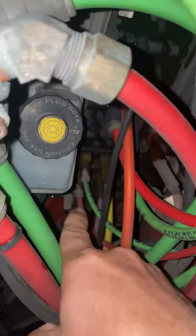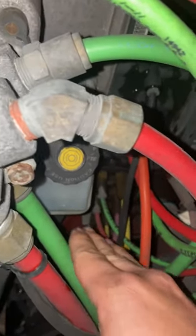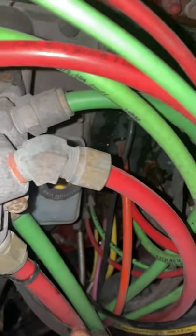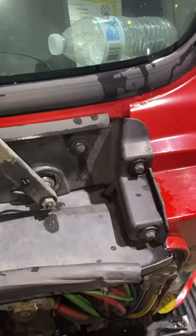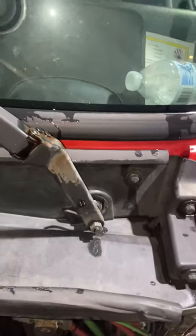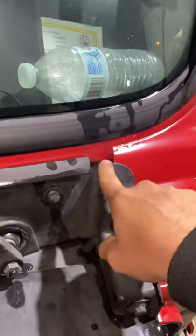That water will also eventually go inside and get your truck floor rusted, because that water is going to find its way inside the truck. Want to know how I know? Someday I might show you pictures of something I had to deal with in my own truck. So your problem is this drain right here — the drain of this water splash guard.